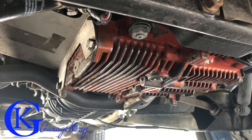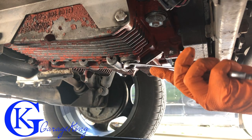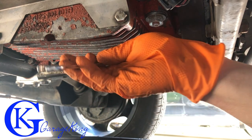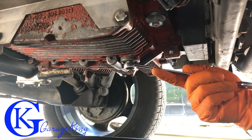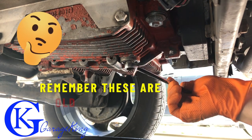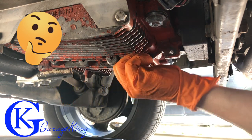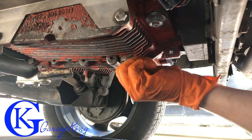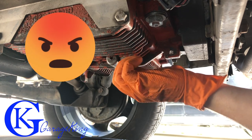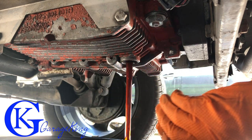I'm going to try to get you a better angle here. There's the oil filter — you can see you can get to it very, very easily. Now what we're going to do is remove the drain plug; I do have a drain pan underneath it. The factory — I'm not even sure what wrench size you're going to use. This one was a 14 or a 13, but these vehicles are so old, people have replaced drain plugs, so you'll just have to see what size is underneath your Vanagon. I had to re-thread mine, because whoever owned the van before me stripped it out. The threads on mine are metric 14×1.5, but I don't think those are the factory threads.